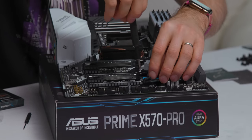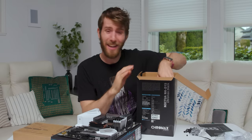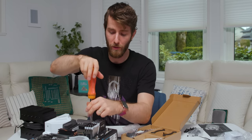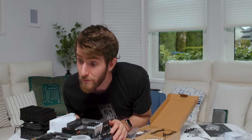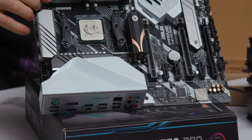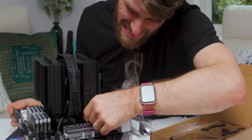That's Gen 3 — boo, hiss. Time to put a heatsink on this CPU. Now you're probably thinking: an NH-D15 Chromax Black in that compact case? And I would reply: yes, weren't you paying attention? Here's an important tech tip — if you have a heatsink that doesn't use the original mounting bracket, keep it safe; you'll need it if you ever RMA your motherboard or change coolers. We're only using the backplate, so the rest goes back in the box. I'm only installing one of the fans here — purely for looks. You can also save money with the S version of this heatsink that only comes with one fan.